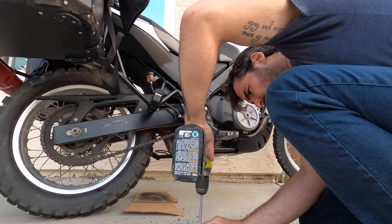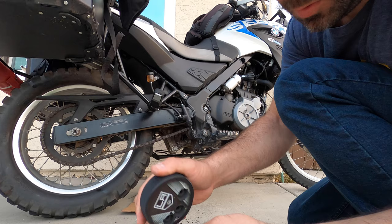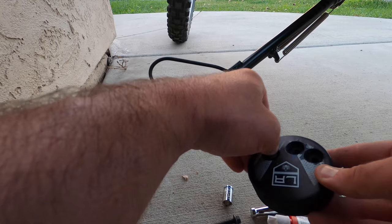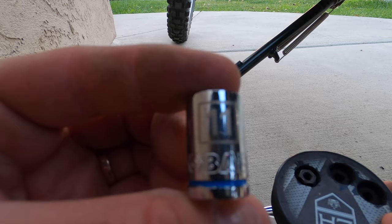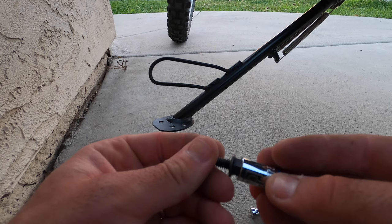The bolts I use are purposefully a tad bit longer, by about a millimeter or two, that's about an eighth of an inch, because I wanted them to stick out just a little so that they could actively grip onto the surface. Careful though not to use bolts that are too long, because then the contact surface are only the tips of these three bolts, and they can also bend and break more easily. Be aware also that they will scratch any surface they rest on. So if you park on finished flooring, for example, like I do, it might be a problem.